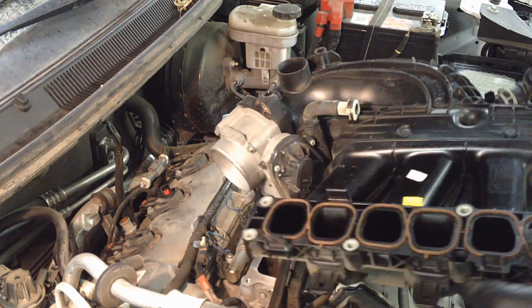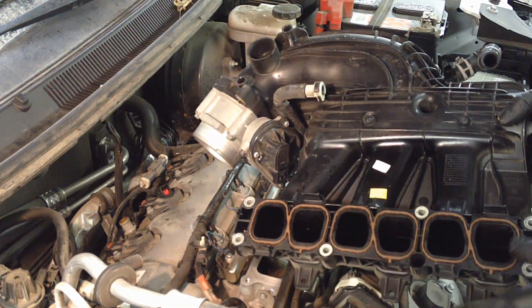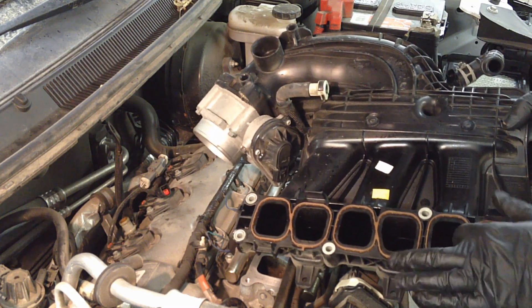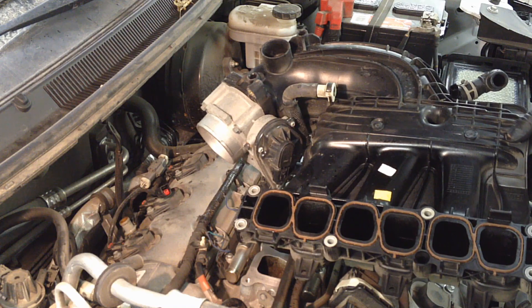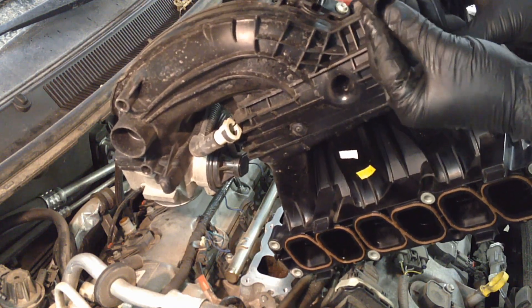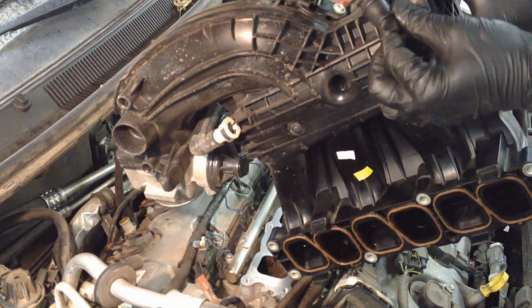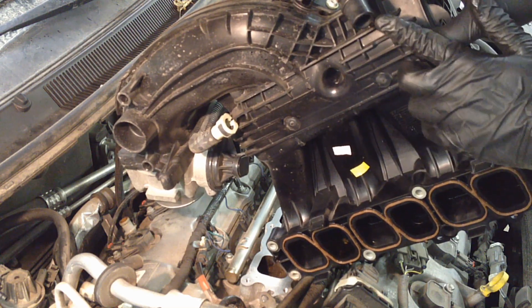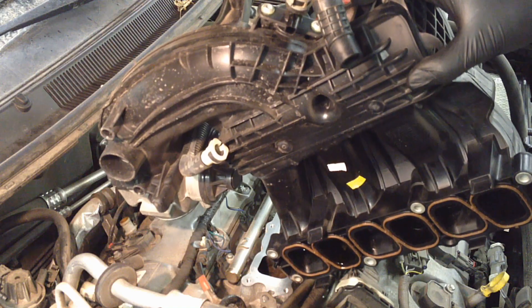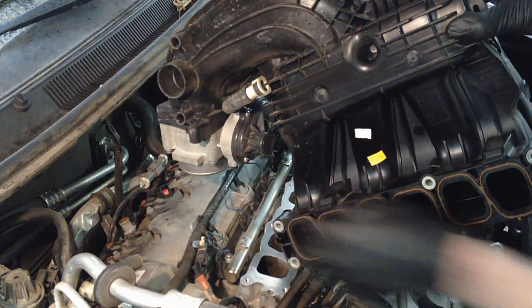I've got my new gaskets on here — all pushed in, changed out, and cleaned up. You're going to see some oil in the intake — don't freak out about that, they all have that; it's carryover from the PCV system. Speaking of PCV, here's the hose that actually feeds the intake and it's nice and oily, maybe a little swollen. Make sure you clean it with brake clean before going back on so it sticks back onto the PCV port.